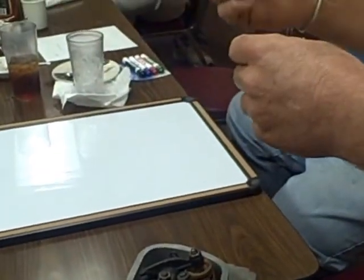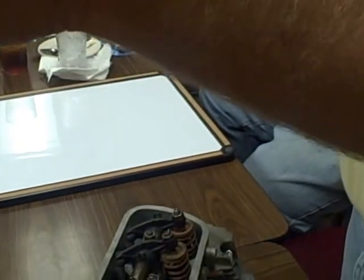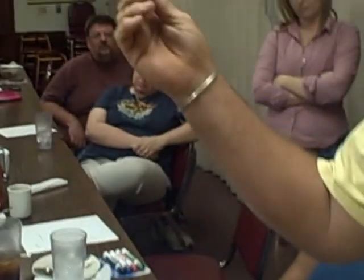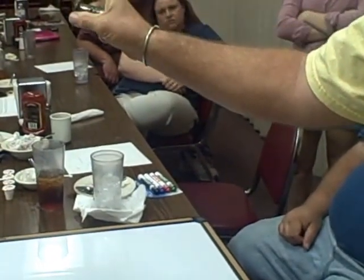All Volkswagens except for Type 4s is solid. Type 4s are hydraulic — some of them. Except for Mike's, his is hydraulic. These are solid. And this is what that guy said went bad on yours — he cut the whole bottom off of that. If you look at this one, it's pretty pitted.